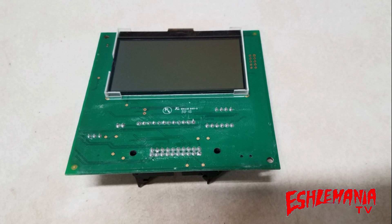The serial number tells this board what it's going to be, then this board tells the HMI board what model it is. The HMI board is the same in all the 400 and 500 series Automowers, but because the motherboard says it's a 450X, that HMI board can only be used in a 450X mower going forward. Now, if you have to replace the main board, the existing HMI board will say, 'We're a 430X — you can't be a 450X main board.' If you try to take a main board from a different model and put it in, it's not going to work, because both boards are set up to work together for the same specific model.